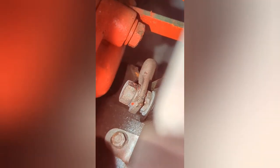What I'm checking now is whether it grounded out when I touched the two wires together to bypass the solenoid — and if you look real close, yeah, it sparked out. That means there is a short inside the starter and we have to take the starter off and have it rebuilt.